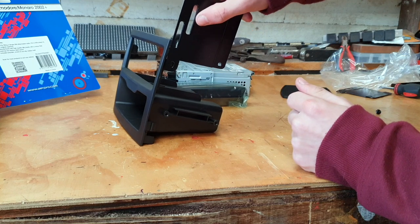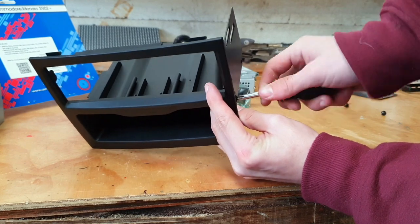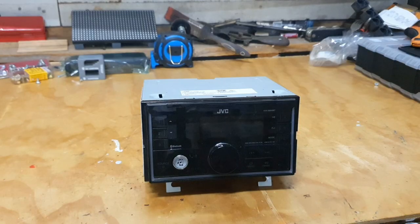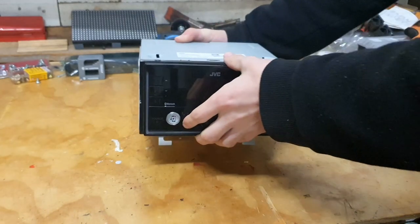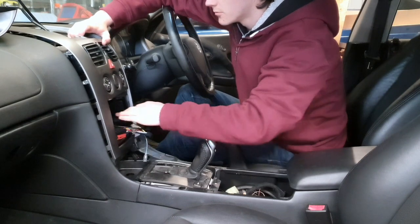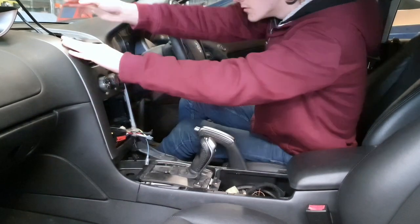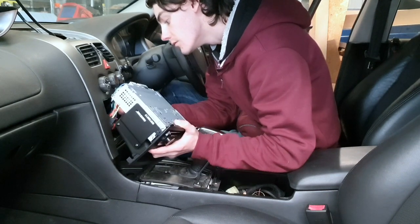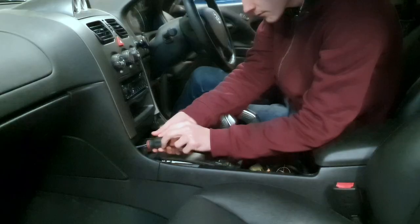The pocket is next — the metal plate needs to slot into the top, move down, and be fastened with the included screws. Slide the head unit in and fasten it down. If you have a double DIN head unit, you'll receive side plates that screw in with two brackets at the bottom to fasten into the car, and you'll need a fascia plate to cover it. Double DIN head units go in first and get fastened by the front screws; single DIN goes in afterwards. Put the centre piece back, connect all the wires, push the stereo in, then screw and clip all pieces back. Make sure you hook your window controls back up.